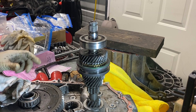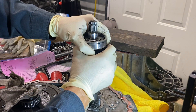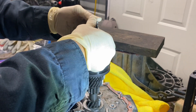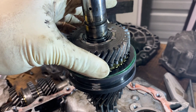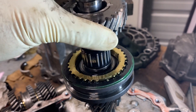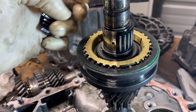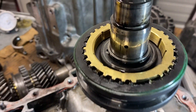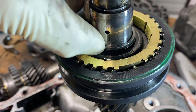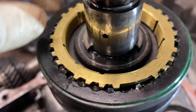Okay, I'm back at the workbench. I put this guy back into the transaxle case, so this bearing is no longer on there. Got that thing off. Now we can take off fourth gear. The needle roller bearings come off in halves - that's what they look like right there. And then here's the little spacer coming off. And then there's the snap ring right in there.